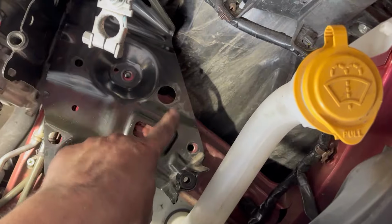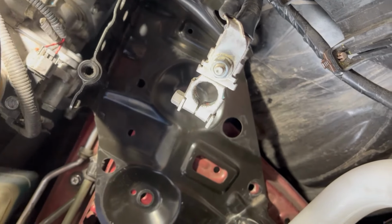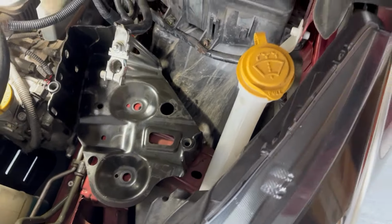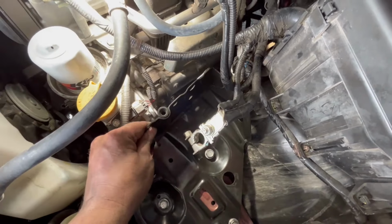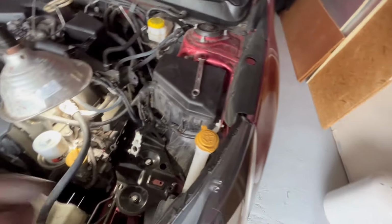All right, so now we got to figure out, get this set back in there where it belongs, because there's three bolts up here, 2 down there on the side, which my light doesn't want to cooperate. There's 2 down there, and then there's 1 down in the middle of all this up there in the frame rail. So what we're gonna do first is get these 3 started, get that one started, and then I'll work on these 2. Okay, not really gonna be able to show putting those in down here on the side, but currently I have these and then the one back over here in, so it holds it, but it's just loose and sloppy, so I can get down in there and get those 2 back in. So I'm going to start with the bottom one because I actually have to use a wrench to tighten them down, but I'm going to start with the bottom one, then do the top one.